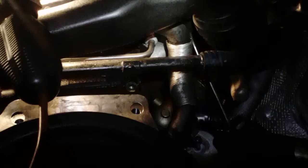One other tip: if you forget to put the dust shield in before you put the new flywheel on, you can just snip it right here and get it back on — no big deal. Good luck, hope this helps you out a little bit.